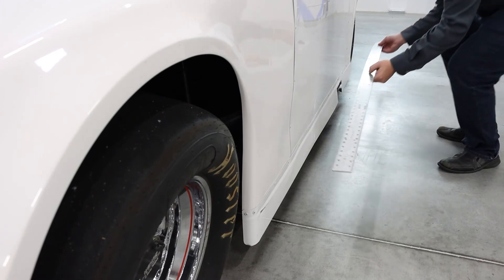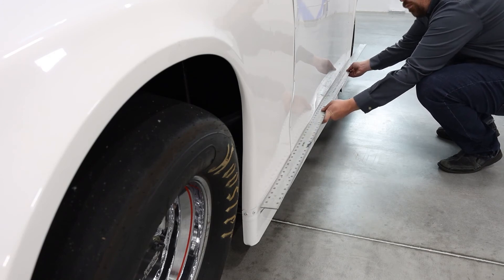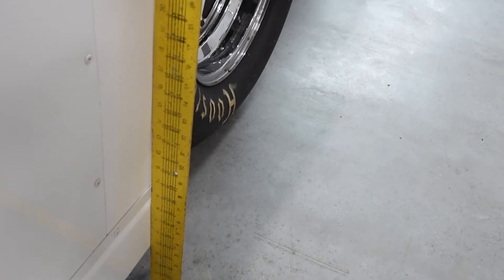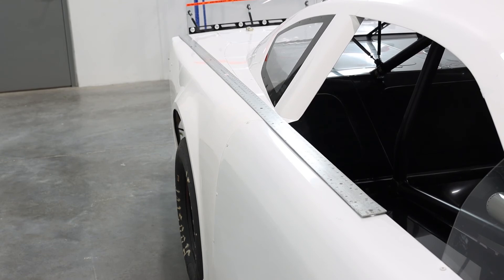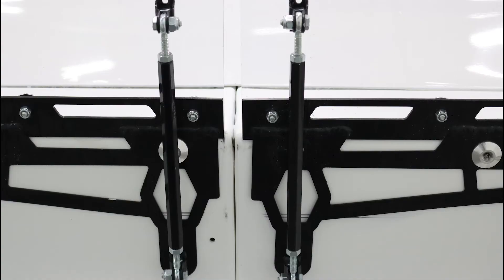Different sizes of straight edges can be used for various inspections. This straight edge is used to ensure that the rocker panels are mounted in a single plane from front to rear. A smaller straight edge can be used to ensure the bumper cover and deck lid are mounted in the same plane. A framing square is used to ensure the fender, door, and quarter panel are perpendicular to the ground for the first 15 inches; the maximum gap is 3/8 of an inch. An 8-foot straight edge is used to check the proper location of the spoiler — align it with the top inside edge of the right door and the hash mark at the top of the quarter panel. The right edge of the spoiler must be within 1/4 inch from the straight edge, and the spoiler blades are to be mounted an equal distance from the seam in the bumper cover.